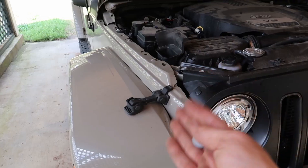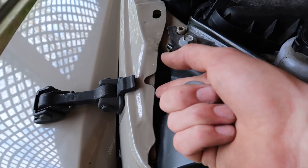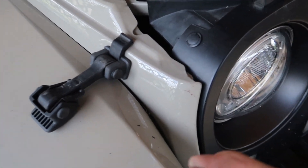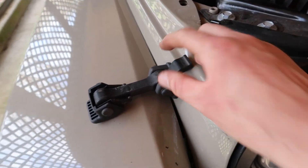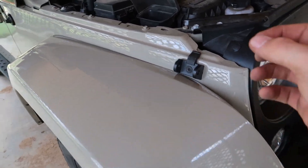That's the driver side done. On the passenger side, to remove this hood latch is exponentially harder than the driver side, which we already thought was kind of hard. If you notice, you can't go straight through here because of too much of an angle, and you also can't get through here because of this metal bar. What you have to do is come up underneath this inner fender right here. If you go up through there, you can actually grab that bolt — you get just enough to get one click on a ratchet, slowly loosen it up by hand, then undo that bolt and pull it off.